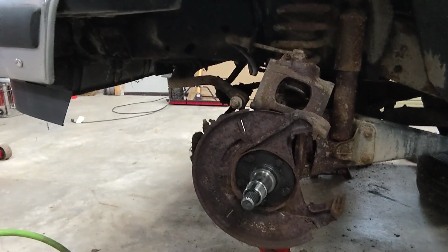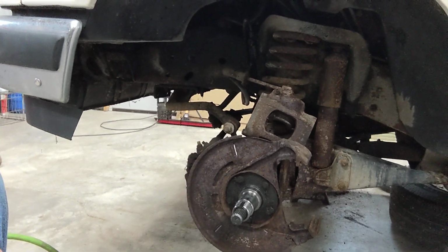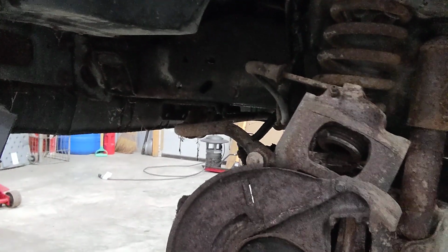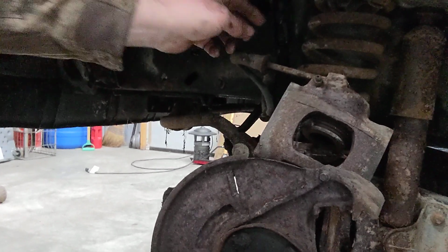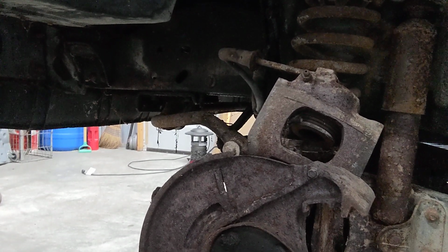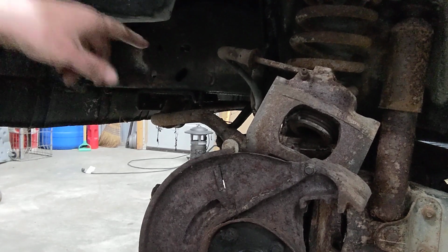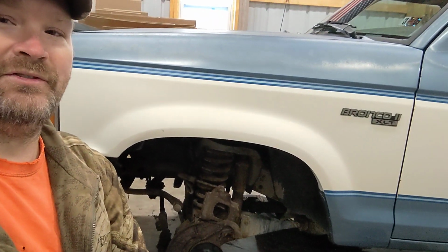I think I know a guy that has maybe 1 or 2 or 14 of those spares laying around. So I got the brake lines juiced up, hopefully getting them ready to come undone. I'll probably throw a little bit of heat at them, try to keep them from twisting off the hard line there, but we'll see. It's always a very real possibility whenever you're doing this kind of stuff, is the rust just sort of goes and goes and goes, and you just sort of replace everything until you find the end of the rust. Anybody that's worked on anything in northern states knows all about that.